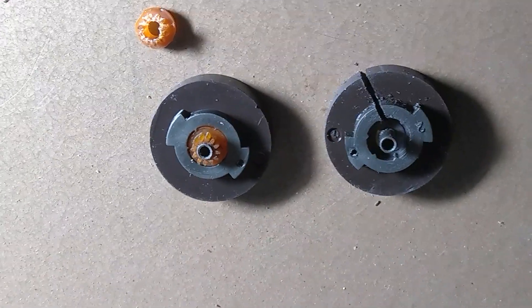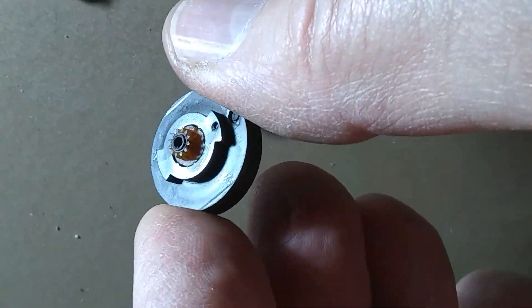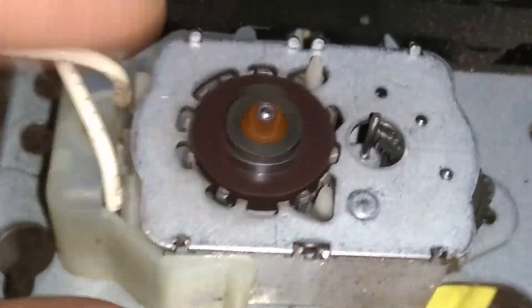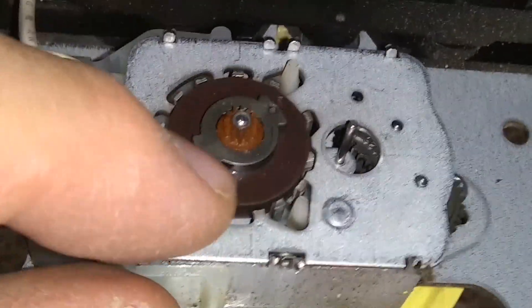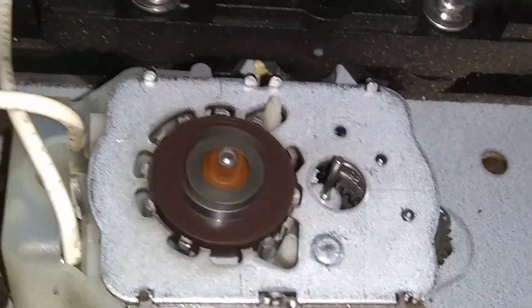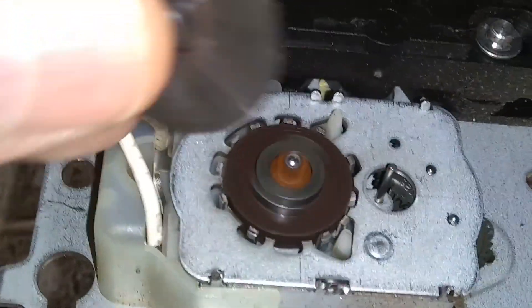This is what it looks like, and now I'm going to place the rotor back in the timer. The rotor can spin either way — right now it's spinning clockwise, but if I stop it and move it the other way it will spin counterclockwise. To determine the correct spin direction, I place the little flag in the corresponding gear position, which will determine the direction of the motor. I'll position it upwards first.